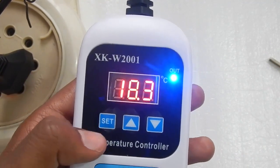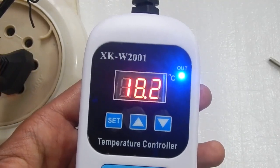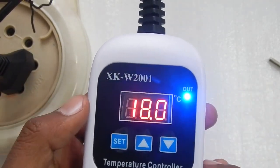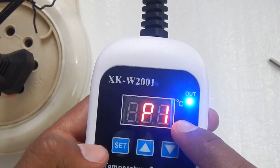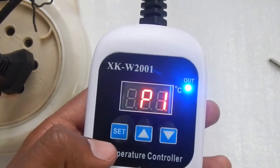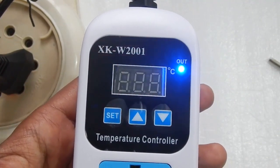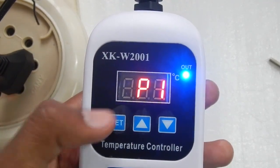Leave it there and wait a second until it stops blinking — the starting temperature is now set to 24 degrees Celsius. To verify, press set, go to P0, and press set again; you can confirm the starting temperature is 24. Now let me set the ending temperature at which we want the thermostat to turn off. Press the set button, then the up button to reach P1. P1 is your ending temperature. We want to set the ending temperature to 26 degrees Celsius.